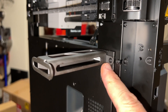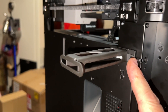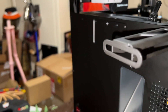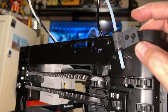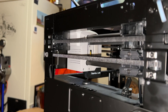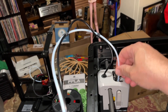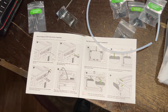You've got a couple screws here to hold the filament spool holder. One screw comes out and replaces with two screws that come in their own envelope. It's a full holder. Then you have this Bowden tube holder that goes in, in its own bag. Two screws go in and tighten down, then it stays loose. Then you'll have the tube and wire tucked in — you shove the tube one end down in there and one end into here.